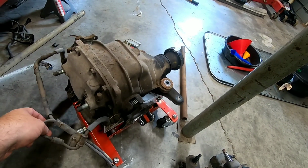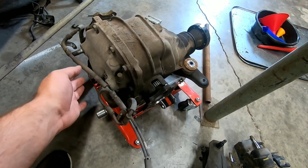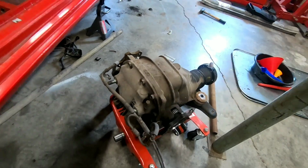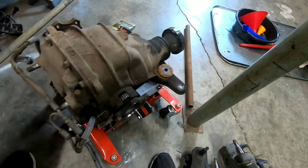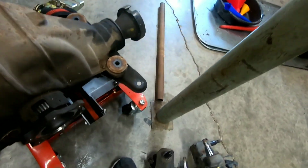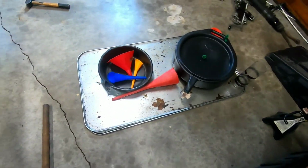These are your ABS sensors in the back, like I was talking about. One plug here, unplugs them all. You need to undo the bolts that hold it in. I didn't show you that. I mean, they're there, but I didn't point them out. I didn't spot them until I was about ready to take it out. As you can see, there's the teeth. That's the sensor. These are the two bolts that are nuts that hold it back in, and the four up front. Let's go take a look at the axles real quickly.